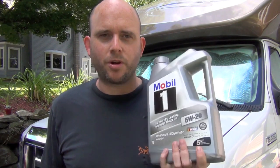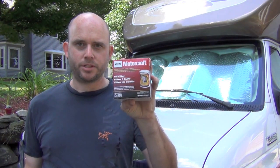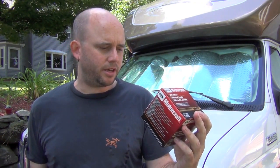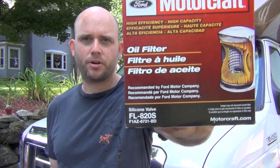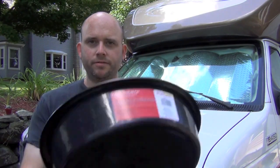You've got to make sure you've got the right parts. I'm actually at my mom's house in New England — a lot of campgrounds won't let you change your oil there, so I figured I'd take the opportunity here. For the 6.8 liter in the E450, you're going to want this filter right here, available at Walmart for about $3.25. The part number is FL-820S — it's a Motorcraft filter with Ford right on it.